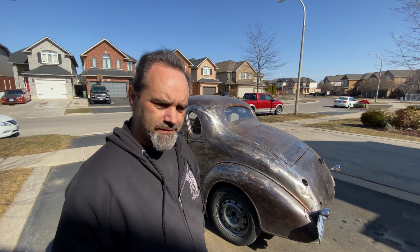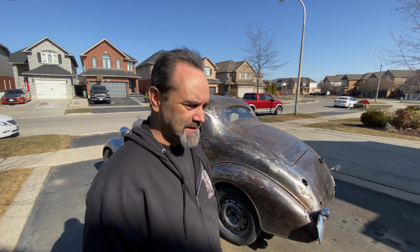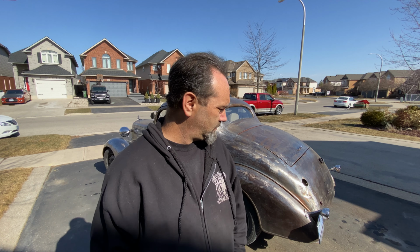Underneath the car then, we have that custom exhaust system that I made, and I utilised a pair of Scat Pack mid mufflers. That's all that's trying to keep it quiet. It does a half decent job, I'll show you that later. We also have a triangulated 4-link suspension system with coilovers and an aluminum gas tank. Oh, I said it was all steel. It's got some aluminum in it. I think that's all there is for the underside, so I will now show you what's going on inside.